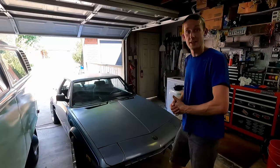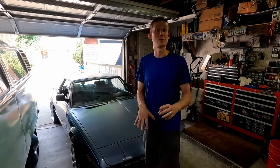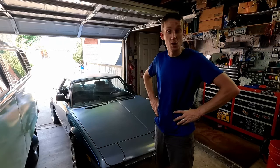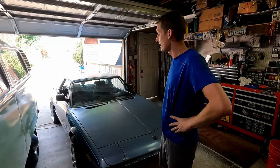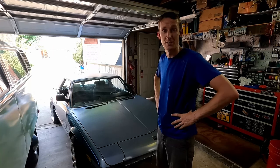Well guys, this is going to be the end of the episode. We were able to set that initial timing and get everything lined up correctly while putting everything back, locking down the distributor, marking our cap up so we knew where everything belonged, getting that set, and it sounded so much better as soon as we got that timing set correctly. And then we got rained out yesterday, which the timing couldn't have been any better on that.